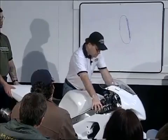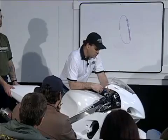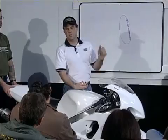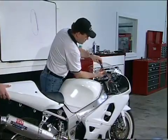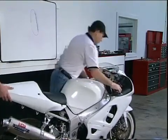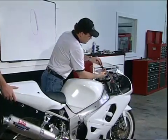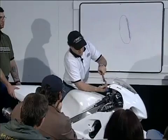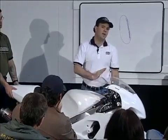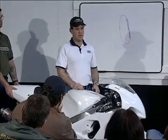Now, what we're looking for again is an extremely quick return. And we want the fork to snap back as quickly as possible, but not do this oscillation thing, okay? So, let me show you what too slow looks like. Actually, what you just saw was too slow, right? You'll crash like that, I guarantee it, right? You'll just go crash, so we don't want that. We're going to go out half, one. See this bike touch the top and just want to settle? That's pretty good to me, where I would go take it out onto the track.